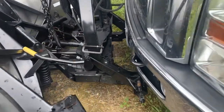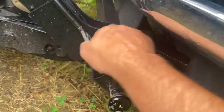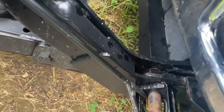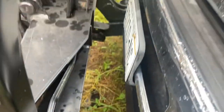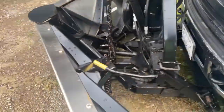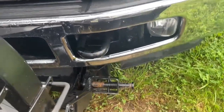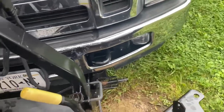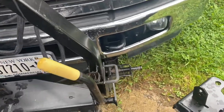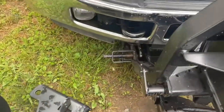I'm up on the front of the truck. You can see the truck piece is right inside the guide here. It's just about lined up. This pin is going to slide forward, and same with the pin on the other side. When you go to lift this yellow handle, it'll actually slide that pin in. If it doesn't slide the pin in, just push here and rock it a little bit and it jumps right in.